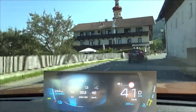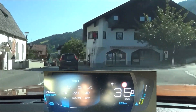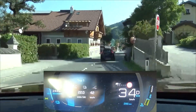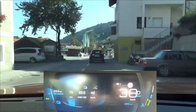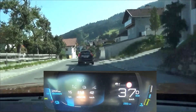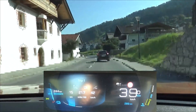We have the power meter on the right side of the dashboard, and if during braking the pointer hits the bottom of the charge section, we have reached the maximum capacity of regeneration. If this maximum is exceeded, the mechanical brakes are used and we lose potential energy for charging the batteries, therefore increasing consumption and reducing range. We have two flat sections on this circa 6 km descent, and there it's important to enter those flat bits with enough momentum to avoid the use of additional energy.